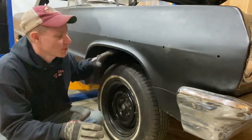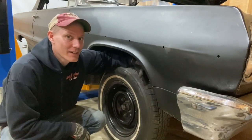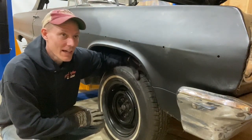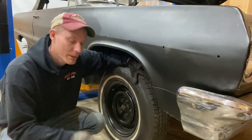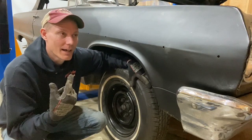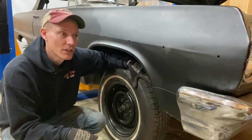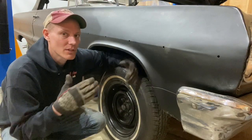Hello and welcome to today's video. We are going to do a brake upgrade on my '64 Chevy Impala convertible. It's a weird upgrade because I already upgraded to a disc brake front setup, and now I'm going to a slightly bigger disc brake setup. I've had the current setup for about 20 years and I've always hated the way they felt. I'm going to a bigger piston front caliper because right now I can push the pedal down and the rear brakes lock up, the front brakes don't work well, the pedal is super firm, and the brake booster doesn't seem to be doing anything. My master cylinder, calipers, and rear wheel cylinders are not matched properly, and that is causing this terrible brake feel.